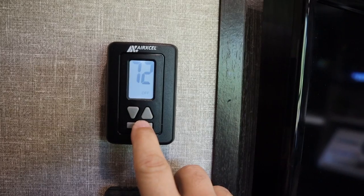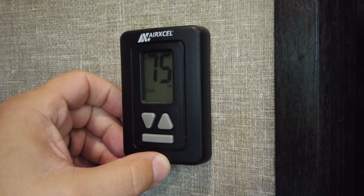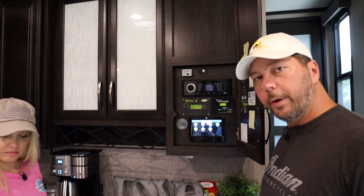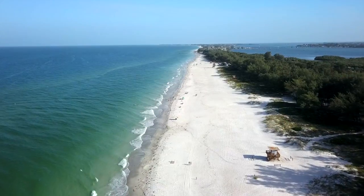Much like boondocking when running off the generator, you want to start your ACs staged — kick the fan on first, let that spin up, then kick on the compressor. Go to fan mode first and then AC mode separately so you're not drawing a huge surge at once, which can pull up to 20 amps briefly and blow the breaker. Now I'll go to fan high, let that spin up, wait a second for the amperage to settle, then set it to cool. The compressor is on — we're pulling 13 amps on leg one, about one amp on leg two, so 14 amps total. We could run like this as long as needed.